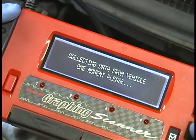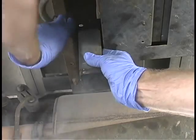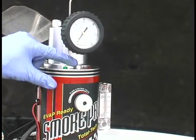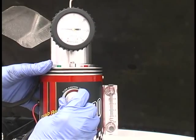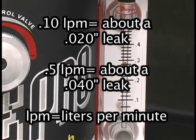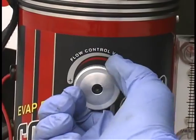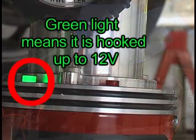If the vehicle is equipped with a vent solenoid that's normally open, it is necessary to close this solenoid using your scan tool before pressurizing the EVAP system. It is also sometimes possible to pinch or plug the lines near the vents to seal the system. With the SmokePro connected to the vehicle's battery and a compressed air source, simply open the flow control valve and watch the pressure increase on the pressure gauge. Take a look at the flow meter to see if air is flowing through the system. Remember, a leak rate of 0.10 liters per minute equals about a 0.020 leak, and a leak rate of 0.5 liters per minute equals about a 0.040 leak. To verify these flow readings, close the flow control valve and look at the pressure gauge. If the pressure in the system is decreasing, a leak exists, and we will now find it with smoke. Be sure that the SmokePro is connected to a fully charged battery.